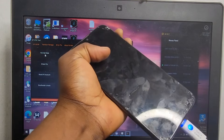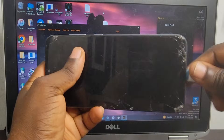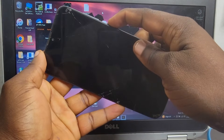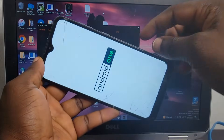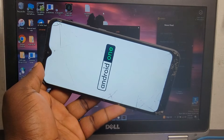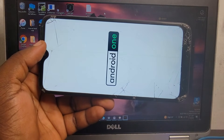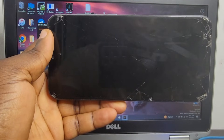My own is now at 60% but I need to wait until it reaches 100%. If your phone doesn't reboot and it's not at 100% and it stops, remove your battery. My own is now at 100%. Remove your battery and connect it again to turn on your phone. Now the factory reset is 100% performed.